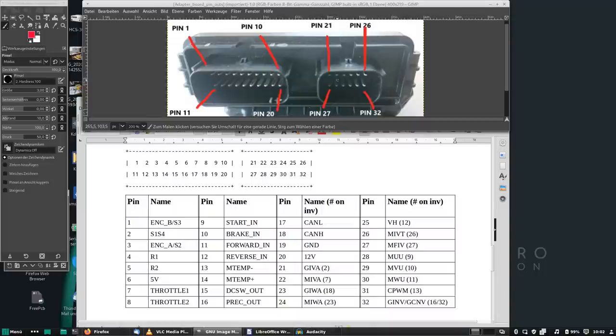So most importantly, these two. This is the phase current one and two of the MG2 power stage. The MG2 power stage is the stronger one, and that's the one that we are going to be using to drive a motor. The MG1 power stage will serve a different purpose. And likewise here on pin 21 and 23, we have the first and second phase current from the weaker MG1 power stage.